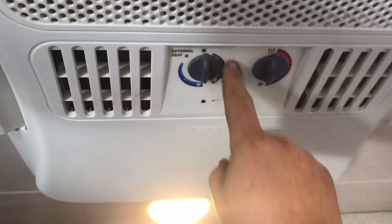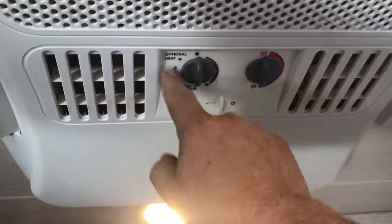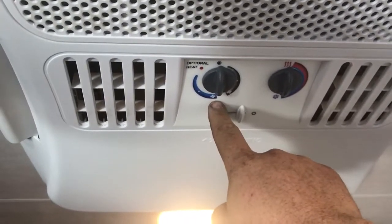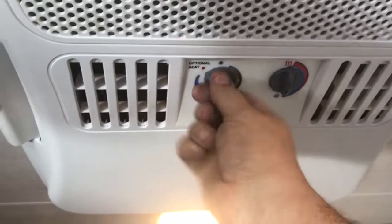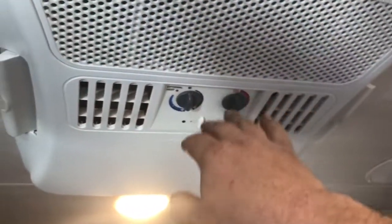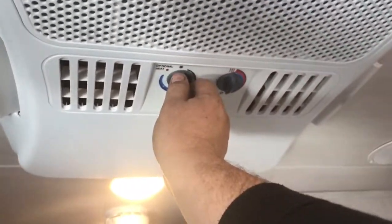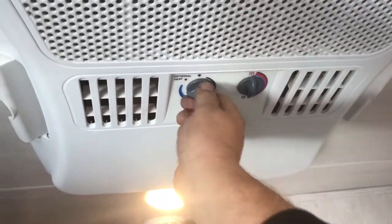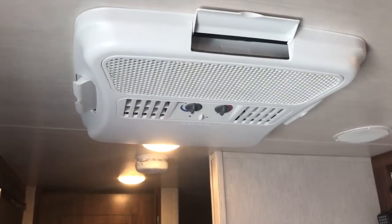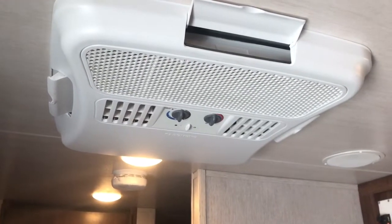Before, what I had to do was go on the fan first, and then while the fan was still spinning, jump over to low and then bring it up. Now I can just go straight over — as soon as the thing kicks on, it's fine. That will work perfectly for boondocking in the summertime to be able to run the air conditioner now that I have that boost capacitor on the air conditioner.